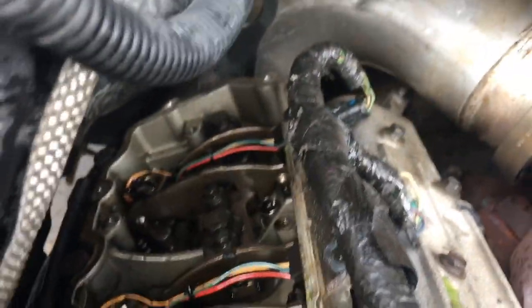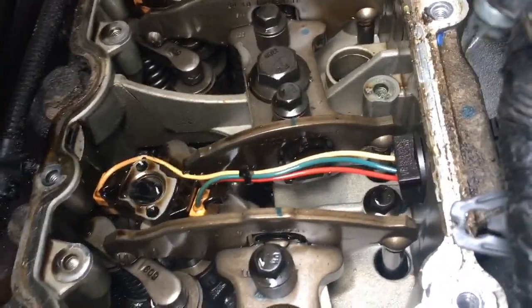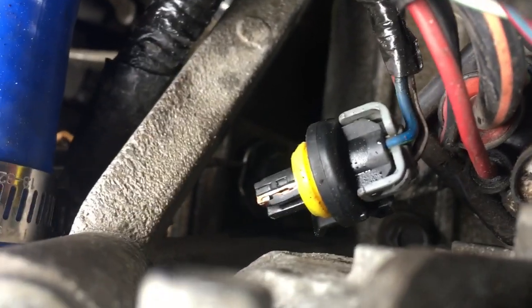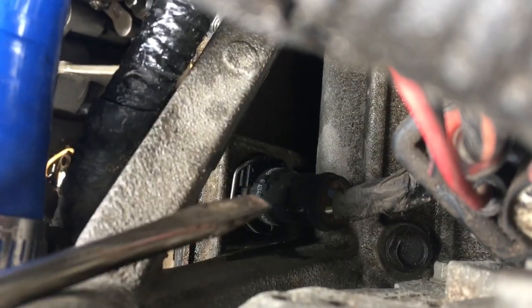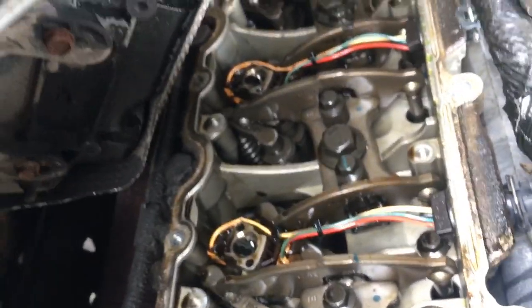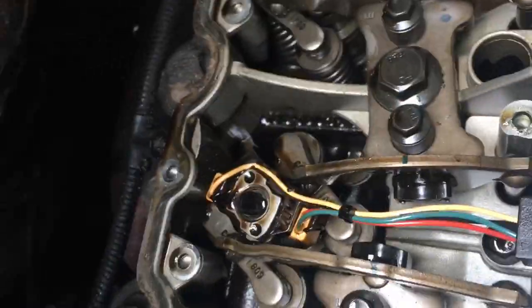Our oil rail is off. The other part of the standpipe is sitting in there — you can see it, just a little bit pouring out. This is our injector number one, the one that is bad. Next thing we're going to do is pop out this clip — you can see the little metal tab there, you push on it and just pull on the harness and it pops out. To push the connector of the injector through the rocker box, use a 19-millimeter socket and just tap on the back of it — it's got a couple of tabs and it'll pop the harness out. If you have an 03 to 06 truck you're going to have a T40 size on the other side there; if you have an 07 truck it will more than likely be a T45 — they did change injector hold-down sizes. Let's get this wiring undone and then we're going to pull our injector out.